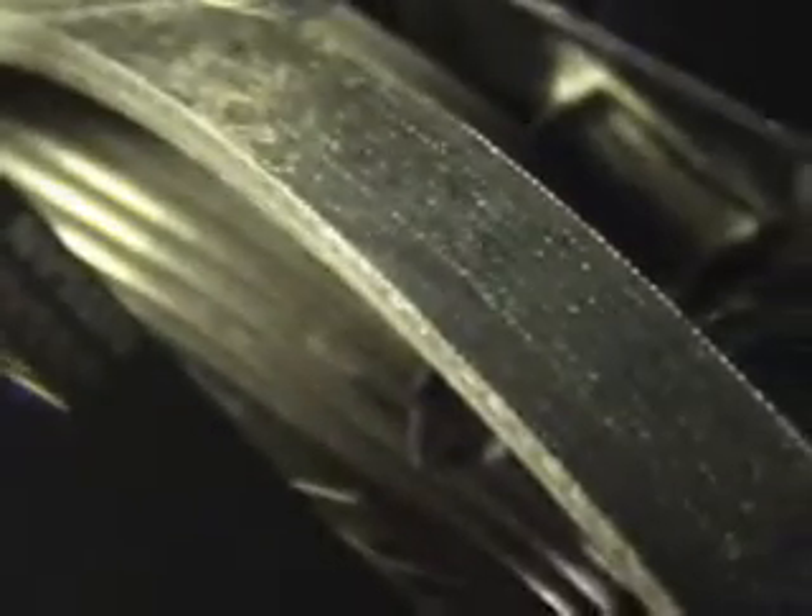Now I'm starting to get puzzled. I still have the pointer at exactly top dead center. It's exactly the first dot - top dead center. The distributor is still pointing approximately to number one.